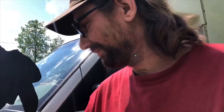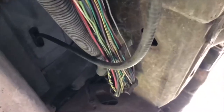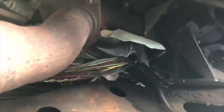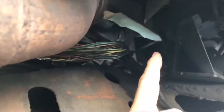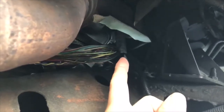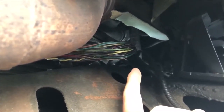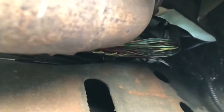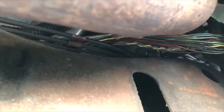Okay, seriously — I'm actually trying to fix the tail light wiring today instead of just goofing around. There is a bunch of melted wiring. Here's the harness — runs along the frame, goes all the way to the back to the tail lights. I followed it all the way up here, and the harness is laying on the exhaust and it has some melted wires. So I'm going to dig into this today. It's a gross dirty mess but I'm going to repair the wires that are damaged and see if that fixes my tail light issue. There's not much to see under here — I'm just going to lay in the dirt and grease and oil and do some wiring. Yay.